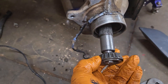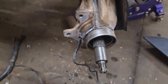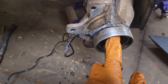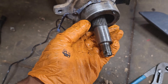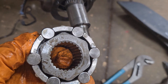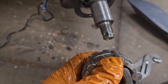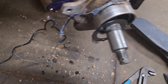Get this bearing out because you don't want these bearings to drop on the floor and gather dirt — dirt is a wear element. Basically what we're having problems with is there's a magnet here, an electromagnet, and what it does is it grabs this plate. This causes the plate to adhere to it, and when that plate adheres to the electromagnet it locks this cam. It causes the inner portion to keep trying to rotate while driving, but the outer aspect of the cam is stationary, and that causes the inner part of the cam to force these rollers — these circular tubes — to expand and grab the entire hub, engaging the forward drive.